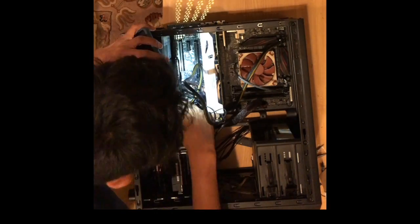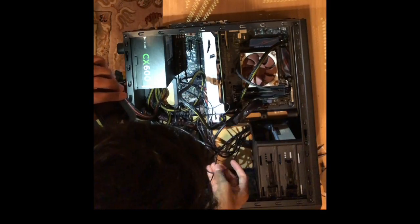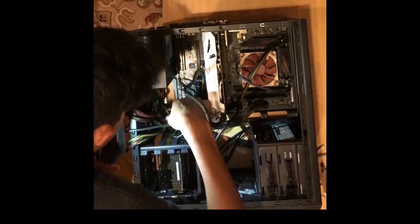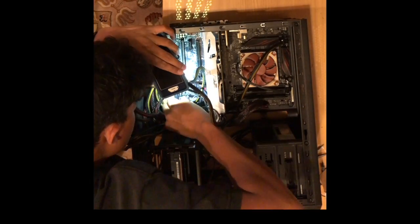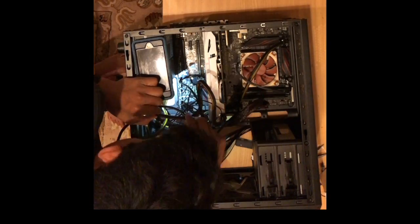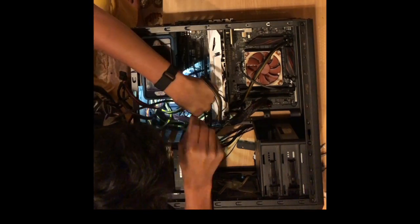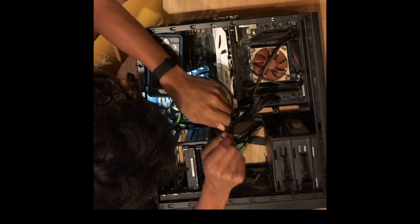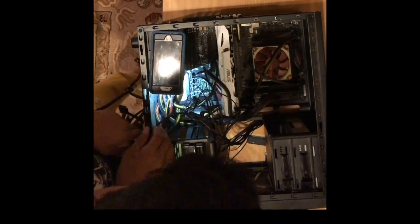Be very careful when putting these cables in, as this also controls your front headphone jack, and if you mess this up, you'll get lots of electrical interference and get a humming sound if you plug in headphones to the front of your case. A better solution for audio from lower end motherboards is a DAC, or digital to analog converter. These converters can sit outside of your case and will not have as much electrical interference, and they will sound very, very good.